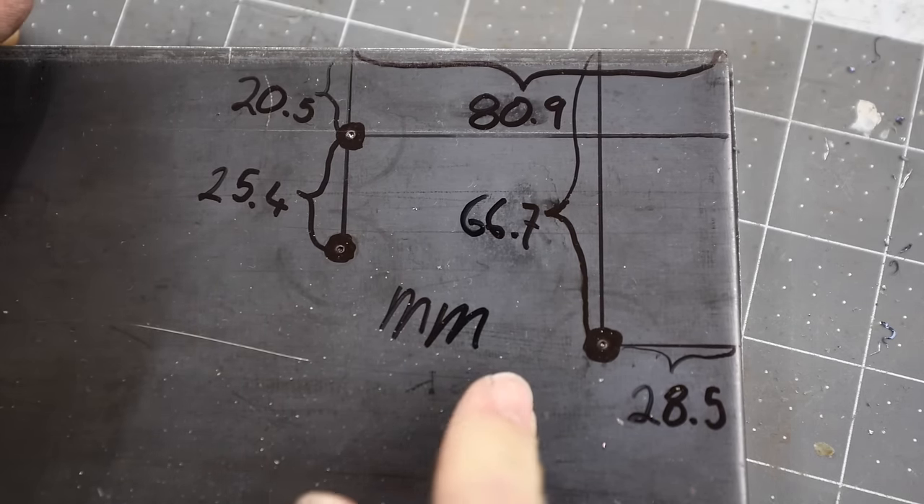Now that we know the bracket is super strong, we're moving on to the body of the awning — the part that mounts to the vehicle. It'll be a simple rectangular frame. I have the three-quarter-inch square tubing inside my bracket trying to figure out how wide I want the body to be. I was going to make it five inches to match the bracket thickness, but I'm glad I didn't — I'm going to drill four holes through the bracket that bolt to the body, and those bolts will go through into the vehicle-mounting bracket. I'm bolting rather than welding it all so I can unbolt it later, make changes, or swap out parts.